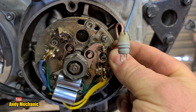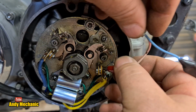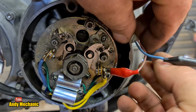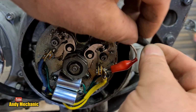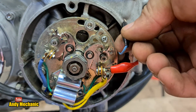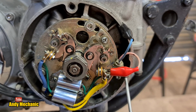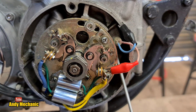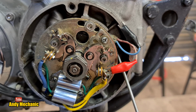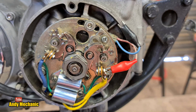Okay, so we'll plumb him onto there. I'm going to tuck, oh, just came off again. Tuck the light down the back, and then just pop that back onto the engine casing. Right, we need this bulb to be down the back really. There you go, that should work. Perfect. Right, time for cylinders 2 and 3, the right hand set of points.